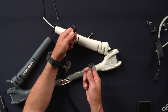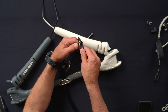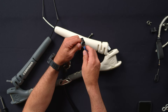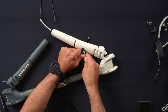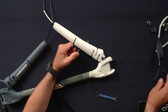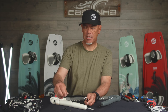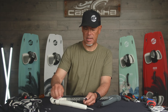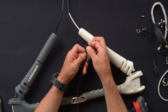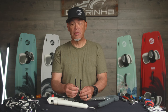Alternatively, you can use a box wrench — this happens to be seven-sixteenths — or a crescent wrench, which is adjustable to fit right around the flared end of the tubing. It won't grab the tubing but will grab the lip of the plastic fitting, and then you can just push it off and work it loose this way. That'll pop right off. Same with the spring clamp — slide it off the end, put those pieces aside. Now with everything off, this will slide out of the cleat. Because there's a little flare in the tubing, there's a little bit of resistance but you should be able to push right past it.